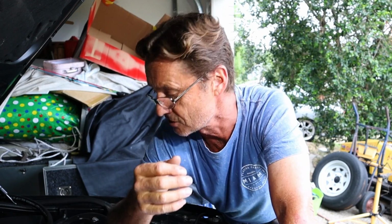incredibly tight. I would highly recommend you buy a new CCV kit. In other words, a crankcase ventilation kit. You're going to be working around the throttle body anyway, which is where that valve's located. So while you've got a lot of the pipework off, you might as well replace that valve now, particularly if you don't know how old it is.